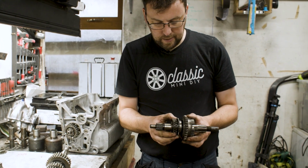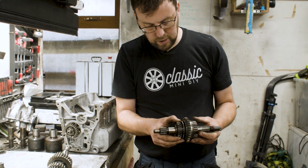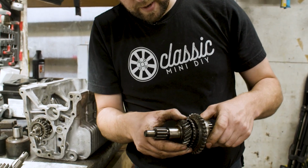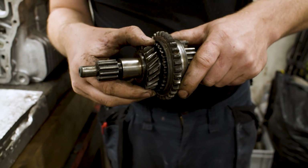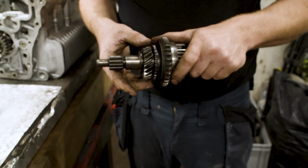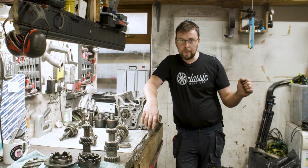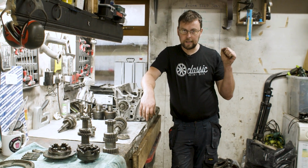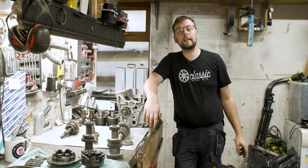So this is the selector and this is the gear, and if the speeds are not very closely matched, you get a thing called toe balking, which is where these are not lined up with those and the gear just simply won't go in, and it has to actually turn before it'll then slip in. That's fine on a road car. If that happens on a road car, it's no big deal whatsoever. You just get a little zip on the gear lever, you hear that little crunch and you say, oops, got that wrong, press the clutch again and get the gear.